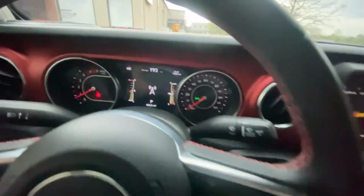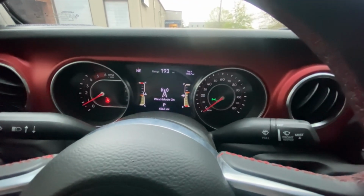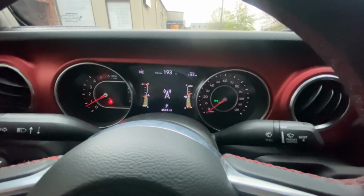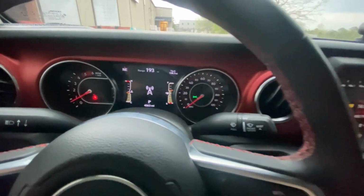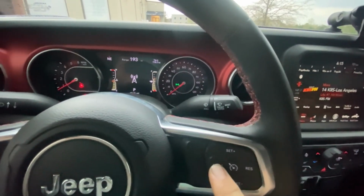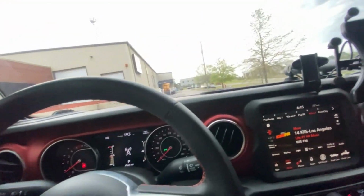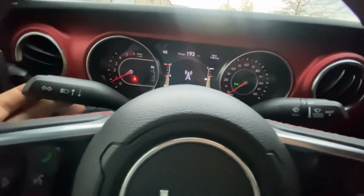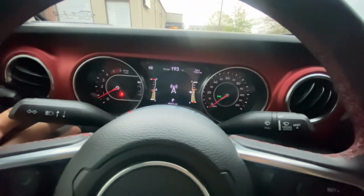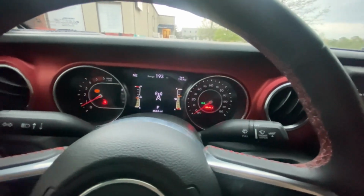On here, this button right here is winch mode. So this raises the idle to 2,000 RPMs while you're winching, and it's used in conjunction with the cool down mode. And check out, this is like one of the coolest features. So while I'm in park, if I hold the brake pedal firmly and pull the stalk, there it goes. So that starts flashing.